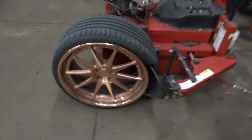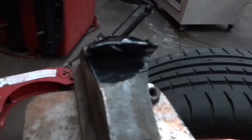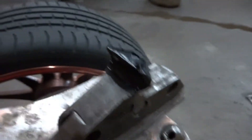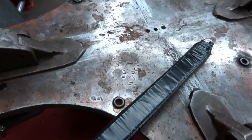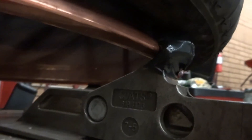This is something to show you about what really goes on. Stuff like always taping the rim clamp section that's going to clamp the outside — luckily these clamp the inside lip of my wheels because of the drop centers in the front. Also, the bar you use for pulling your bead over — anything that's going to make contact with your wheel, protect it and pad it as much as you can. A lot of machines have nylon feet but usually they're broken and fall apart anyway.